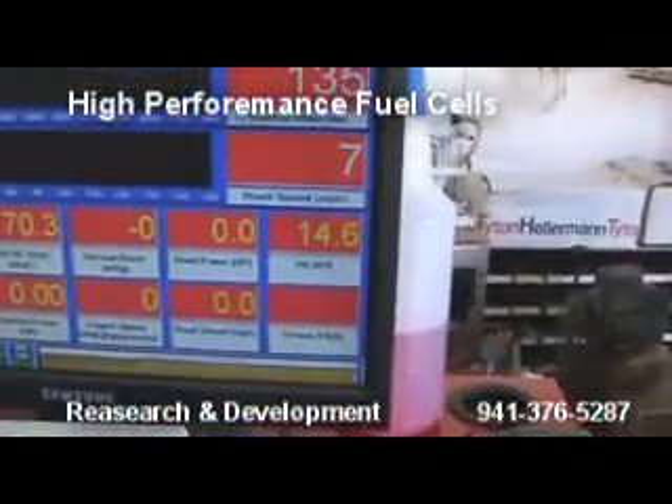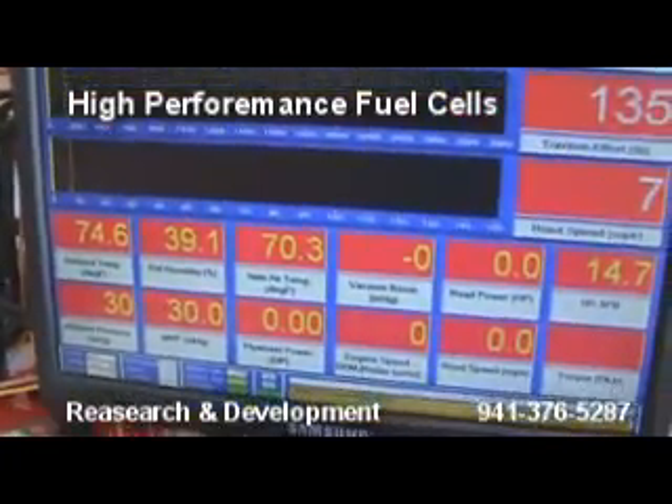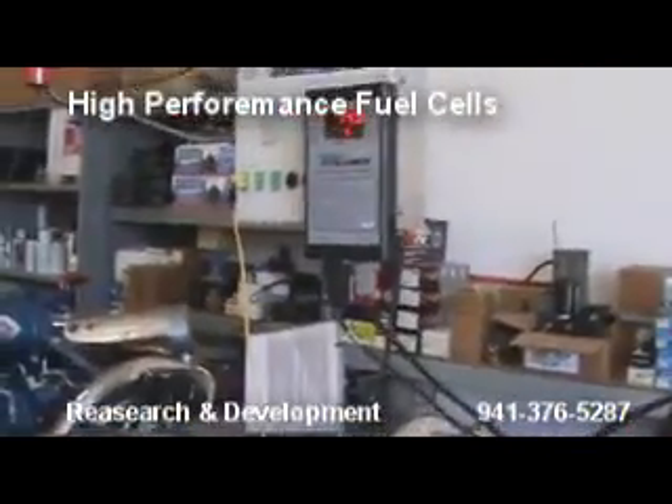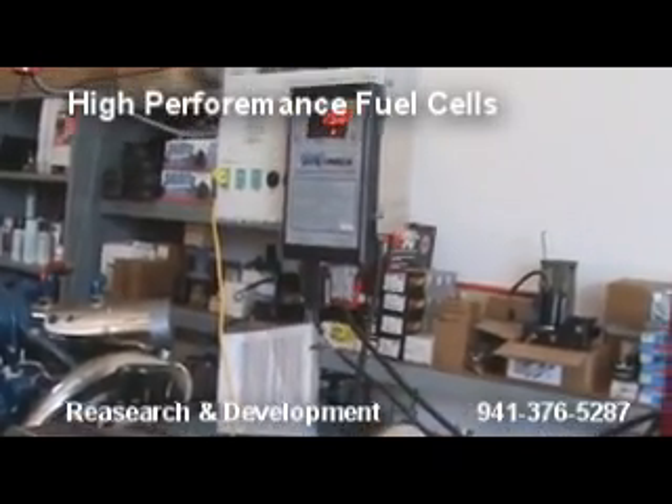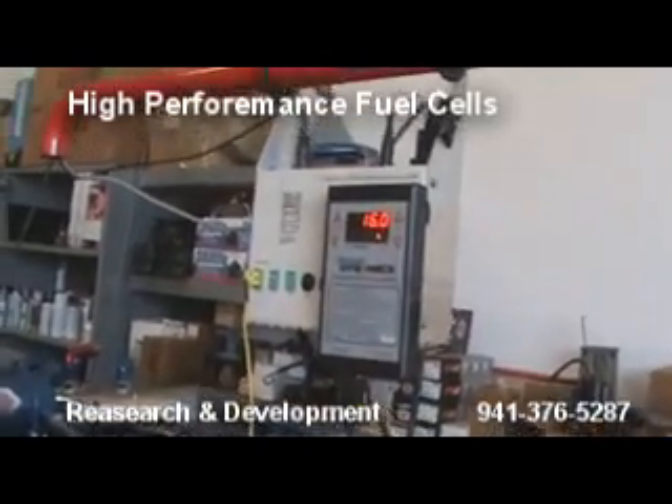We're reading 14.7. It's got too much jet in — it's only open a full turn, it should be a turn and a half. So the front can go down.